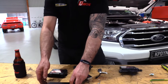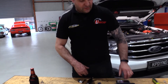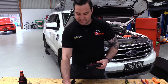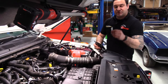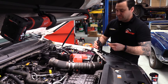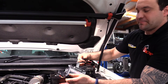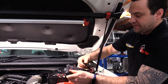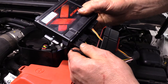You've been supplied with a universal Unichip mounting bracket — this can be mounted wherever it will fit. Mount the Unichip onto the bracket using the supplied M5 screw and nut combination. You'll also notice we've supplied a little sachet of lube — this isn't for your next camping adventure. Apply it onto the Unichip itself to prevent any corrosion. Now we're ready to plug the Unichip harness into the Unichip — the two black plugs are different sizes so you can't mix them up. Make sure you plug them in nice and square and they will click into place.